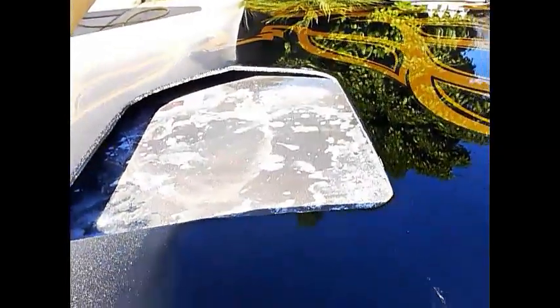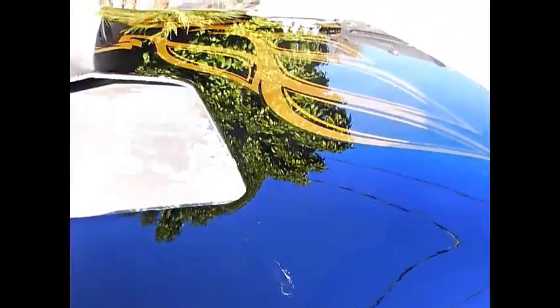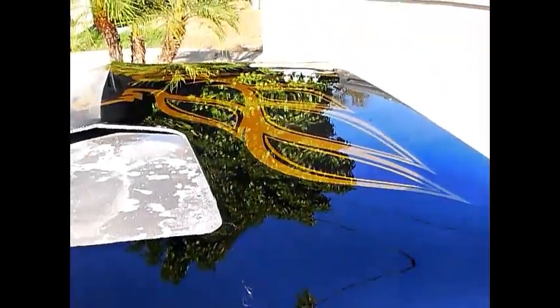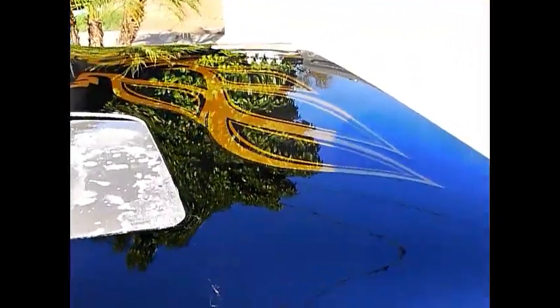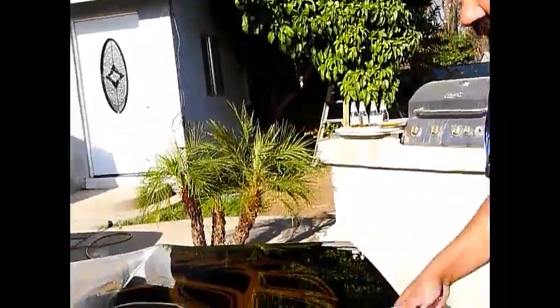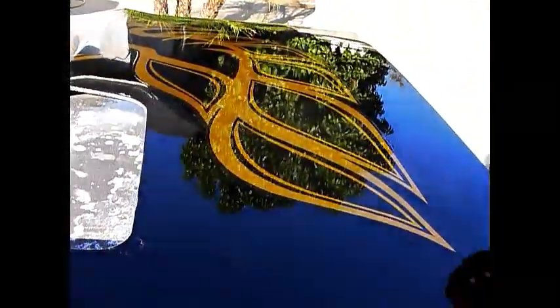Polished off work. So don't really pay attention to that, because that's what gets your self-esteem down. You just see that and right away you think it's a scratch mark. Don't think you messed up. Unless it doesn't come off, then yeah, it's a scratch. Well, then you'll go back and hit it with some rubbing compound again and the other steps that I showed you, and you get rid of the scratch, whatever it is.